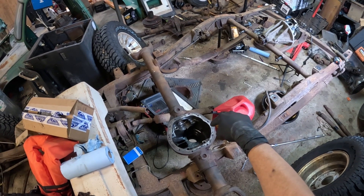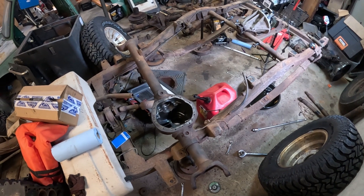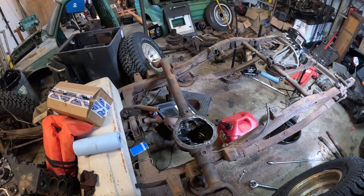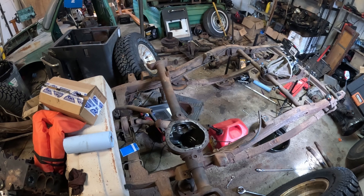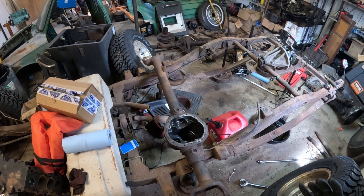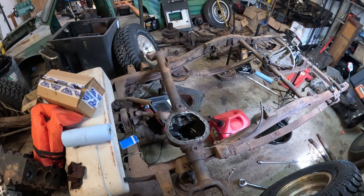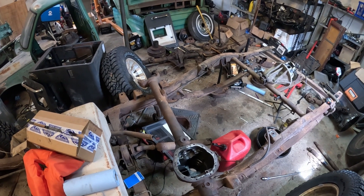There's no more putting it off — we've got to shorten this front Dana 44. This bad boy used to be 65 inches wide, and we decided in the last video that we liked 53 inches for the rear. Typically for off-roaders the front track is a little wider than the rear, but I don't want to go much wider because already at 53 inches my tires are going to stick out one and three-quarters inches over the body. So maybe I'll go 54 or 55, probably not — maybe 54. We're going to do a little measuring, see what we can get away with.